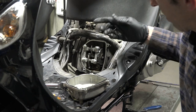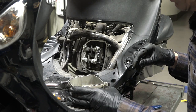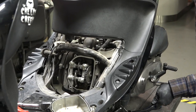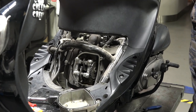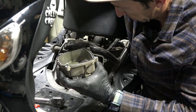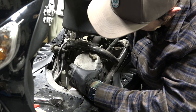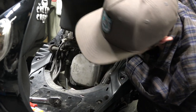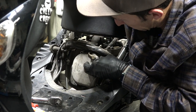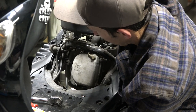Make sure the mating surface is pretty clean. The valve cover itself is pretty difficult to fit into the Buddy while the scooter is up on the center stand. What I'll do is shift it right off the center stand — you may want someone to help, or put it on the side stand. At that point the head shifts down just ever so slightly and the valve cover fits right into place. Make sure you have a good feel that the valve cover gasket doesn't pop out of place, because if you pinch it you'll ruin it and end up with an oil leak. Install the screws finger-tight first to get them all lined up.